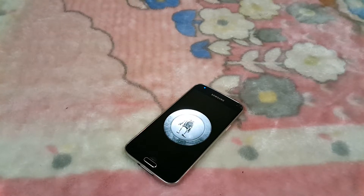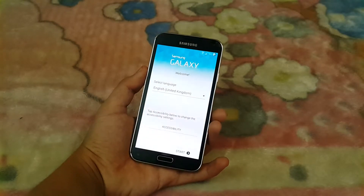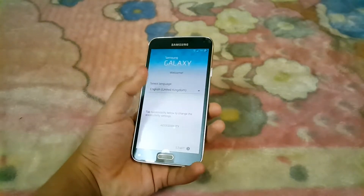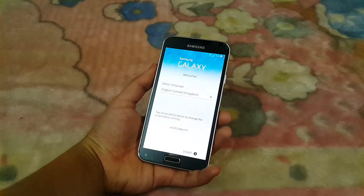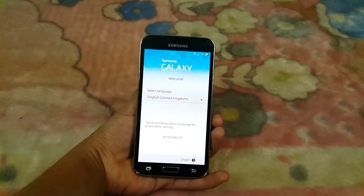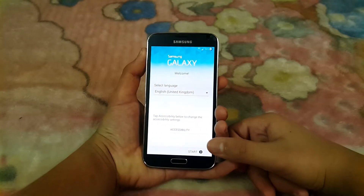It's been about five minutes and it's still booting. The phone is now booted up. I also wanted to mention that if you want to downgrade to an Android 4.4.2 ROM, you will need to first flash the official Android 4.4.2 firmware, because once you install an Android 5.0 Lollipop ROM, you will not be able to downgrade directly.